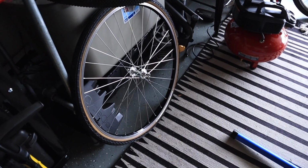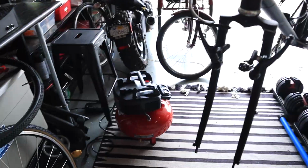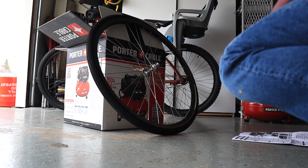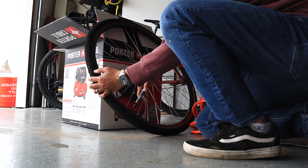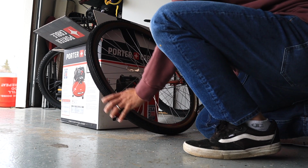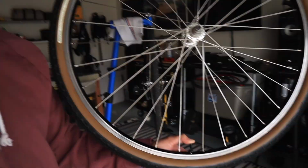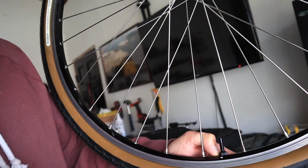We're gonna try now to start that without waking up my napping child and inflate these tubeless tires. What a process. So easy with an air compressor. That freaking worked. Check it out. The beads have been seated. If you're gonna do tubeless, definitely go air compressor. And now we're gonna fill it up with some goop.